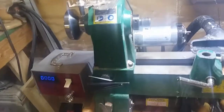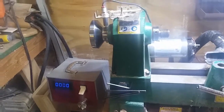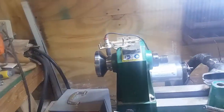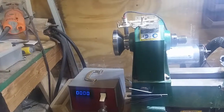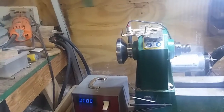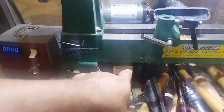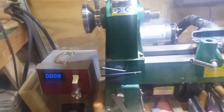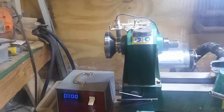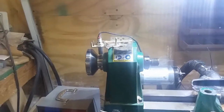Hello YouTube, welcome back to the workshop of the Jack Pine Savage. Today I wanted to do an update video on my lathe conversion using the treadmill motor. There had been some good comments on it, and one recent comment was that it was pretty loud — and yes, I would agree that the treadmill motor was definitely louder than the normal AC motor. The reason for that was the flywheel that blows air to keep the motor cool, but as you can see in this video, I have solved that problem.